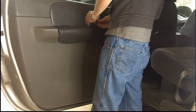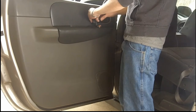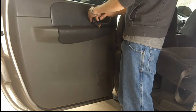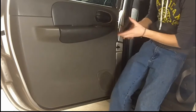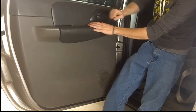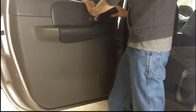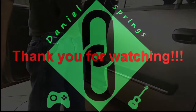Next is the power window controller. I'm going to test the power window and roll it all the way down to make sure there are no obstructions inside that door before fully putting the door panel back on — we don't want to break the glass or cause binding on the inside. Then I put this cover back on and finally test the door again to make sure everything is good to go. If you like this video and want to see more like it, let me know and make sure you smash that like button.